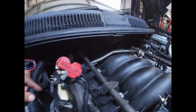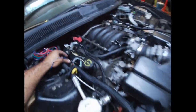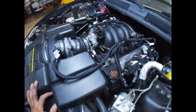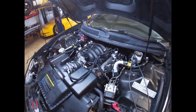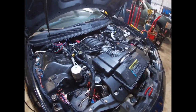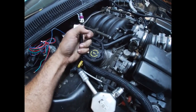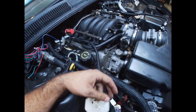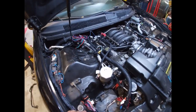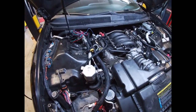If you're familiar with the F-bodies, the cam wire is a pain — it sits way back there. Since he's going to run this as a drag car, it's not running any emissions stuff, so we're going to use the vacuum port on the intake to provide a vacuum signal to the built-in MAP sensor on the Terminator X. The Terminator X does have a connector that'll read a two-bar MAP sensor — you can get a GM two-bar and plug in there — but since this is naturally aspirated, we're going to leave that unhooked for now and coil it up until he decides whether to add a turbo or supercharger.